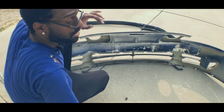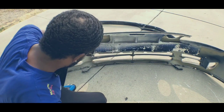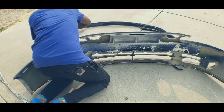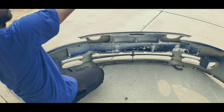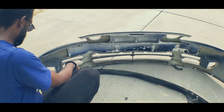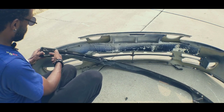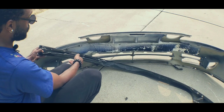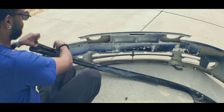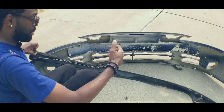Remember, if you do not have a front bumper with the holes drilled in, you're going to want to line everything up with the front lip. If you score a front lip from the junkyard and you do not have holes drilled in your 95 - or whatever base model - you can always line up where you need to drill by corresponding the tabs on the bottom. You'll just kind of go straight up. It may not be perfectly accurate, but it'll do the same thing. The weight of itself can press down and sandwich in.